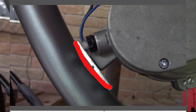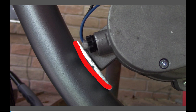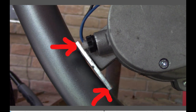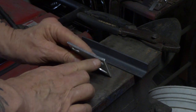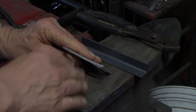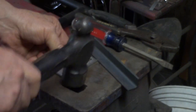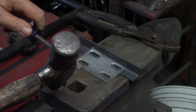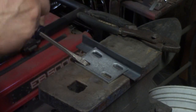Let's take a look at this mounting plate. See that gap there? I want all of that area to be mated together. I want to evenly distribute the load and stress from the mount against the down tube so I'm not looking at possibly cracking the frame in the future. What I'm going to do is put a little bit of a curve into this mounting plate. You can see it's got a little defect, so let's get that lip straightened out. I'm just using a hammer to bend it.